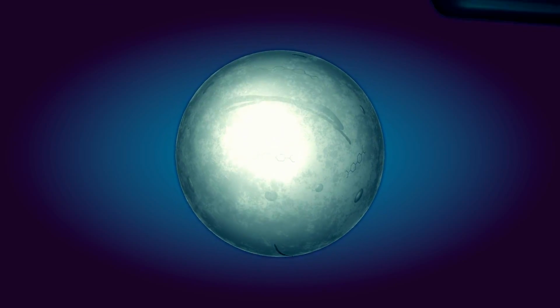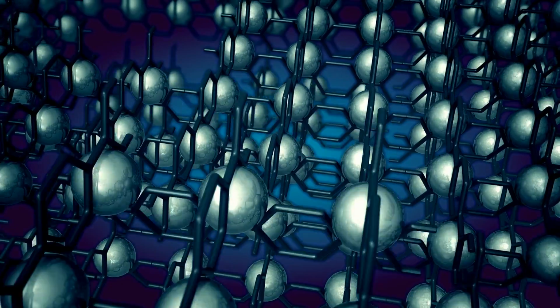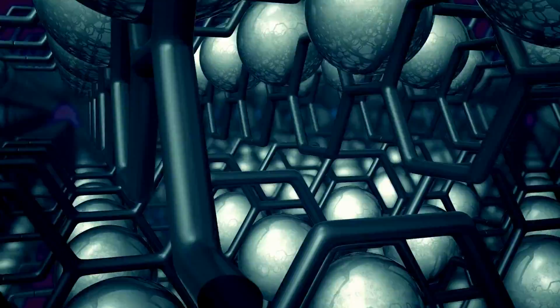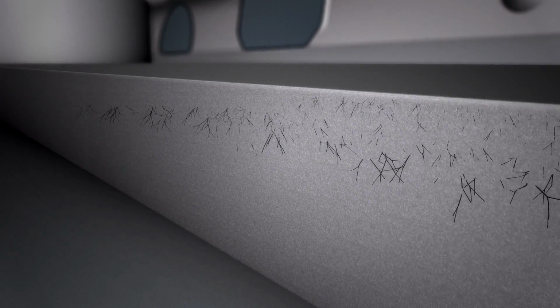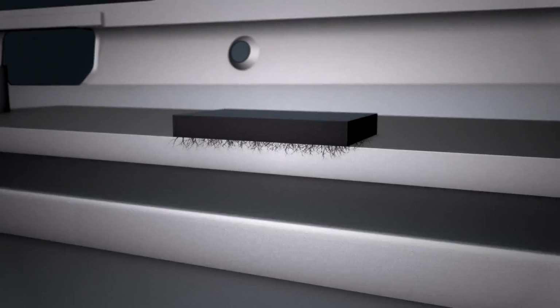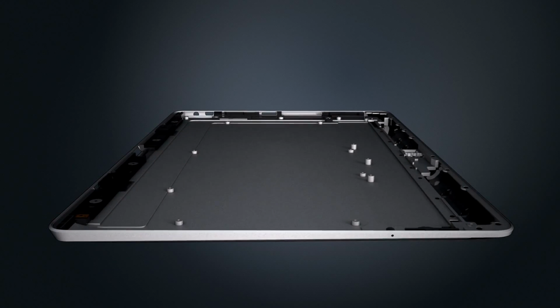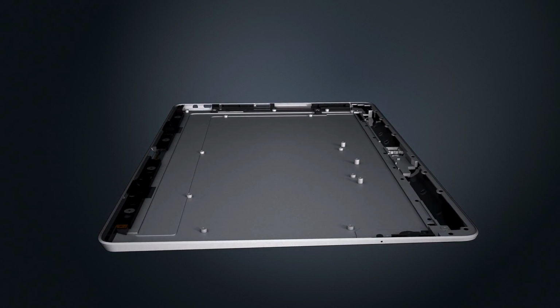One of our primary aims was to keep the Infinity as light as possible. This is when we began exploring nano-molding technology. Molding plastics and aluminum at the nano level using plastic injection causes the plastics to work almost like a tree root, growing deep into the aluminum, creating an incredibly sturdy adhesion. Thus, we were able to do away with unnecessary metal parts, such as screws, and replace them with the much lighter plastics, while maintaining the same strength as traditional methods allow.